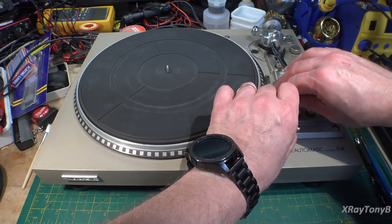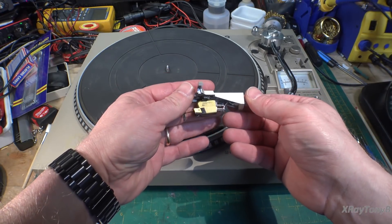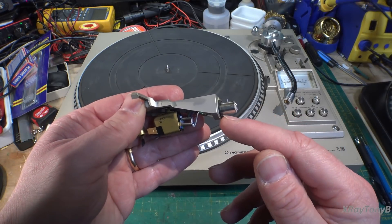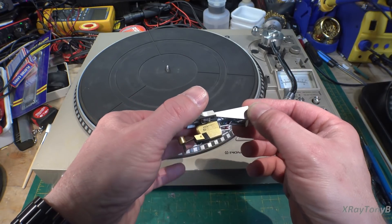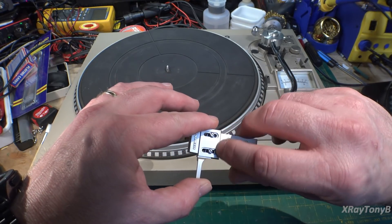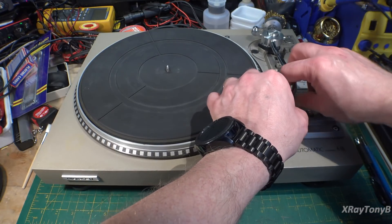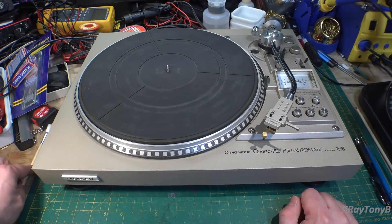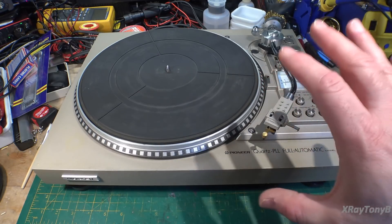On these Pioneer turntables, all the Pioneer headshells just unscrew like this - that's a standard headshell mount. All you do is take a caliper and measure from this rubber grommet right here to the stylus tip. I believe the one that Pioneer uses is 49 millimeters. As long as you set it at 49 millimeters from here to here and set this essentially in a straight line - very very little cantilever angle - you're good to go. You can use all the stylus gauges and things but you'll find it'll fall right into place with the Stevenson alignment procedure.